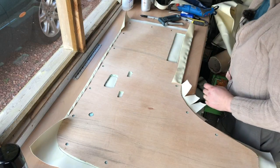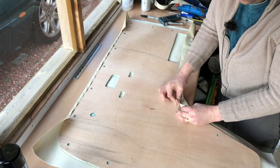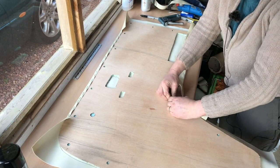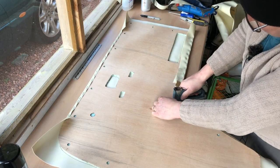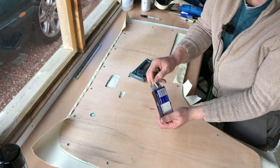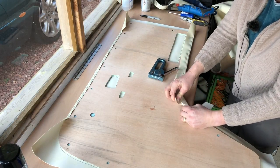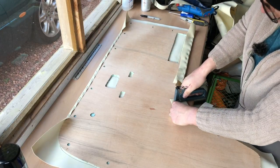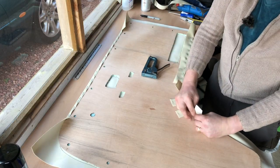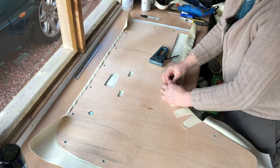Then I'm going to do this inside radius. So I've got all these tongues, get the middle couple, pull them out, pull them over, good stretch. You should be separating them slightly because of the way the radius goes, and put a staple way away from the edge. Whoops, and make sure you don't run out of staples. Try again. Middle two, good stretch. Staple away from the corner. Same again. They're temporary, probably. Stretch it out. Stretch it out.